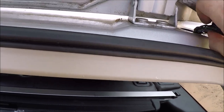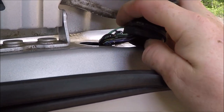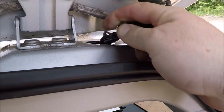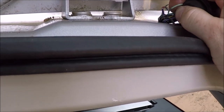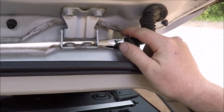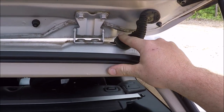We'll slide it up a little bit so we can see. And as you can see, we got the black wire that's broken, this green wire, this bigger red and blue wire here. That one actually looks like it was the one that popped the fuse because it's all black. This green wire, another green wire broken. So you can see we've got a bunch of wires broken in here. These are probably the ones that are going to our defroster, our rear wiper, and our lock.